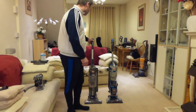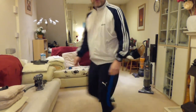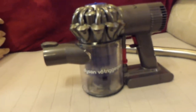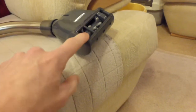So what we're going to do is have a quick look at the features of this. I also have a mini turbo brush here. I'm going to compare the suction on this machine, the cordless, and the mains machine using that tool. How fast the brush turns is basically indicative of how much airflow and suction the machine has got.